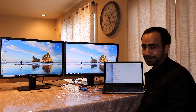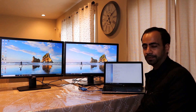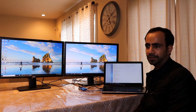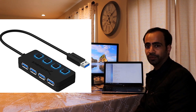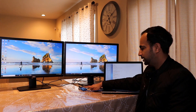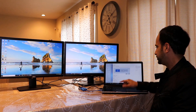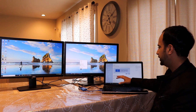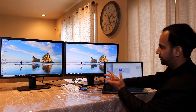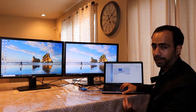So that's how you connect as many monitors as you like to one PC or laptop — just use the USB ports. If you don't have enough USB ports, buy a USB hub or USB extender, then use USB-to-VGA or USB-to-HDMI adapters. Make sure you have the driver for the adapter, otherwise the extended monitors won't appear in your display settings. You can also arrange the displays in any configuration, including stacking one above the other for a vertical setup.